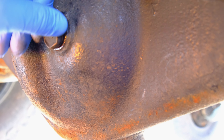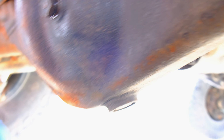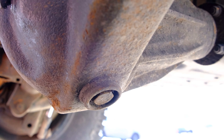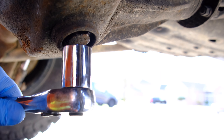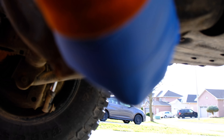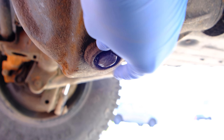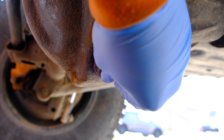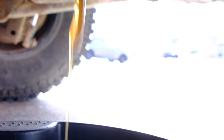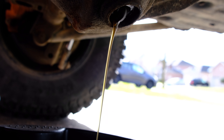That cracked loose — you should hear some air come out. Now that we know that that can be loosened, we can go ahead and loosen the drain bolt. Let's go ahead and see if we can crack this loose. We are good. This should loosen now, and you're just going to make sure your pan is ready to catch the oil. This should be magnetic — there's a difference between the two. My diff oil looks pretty good, so you're just going to let that drain now.